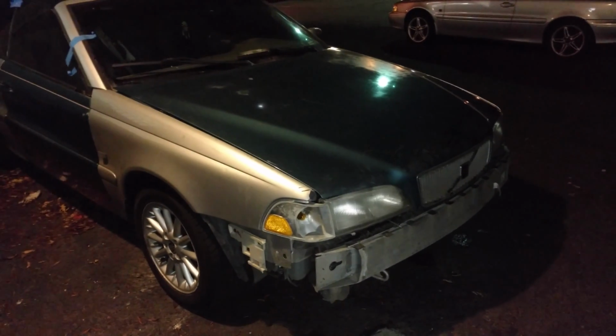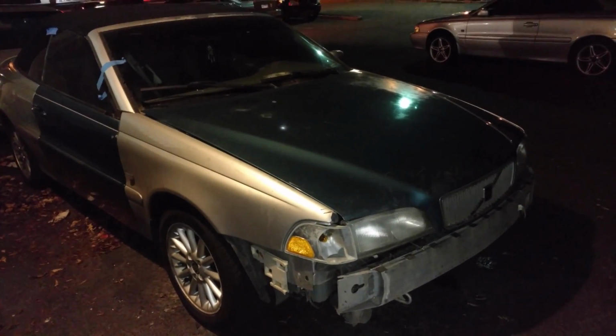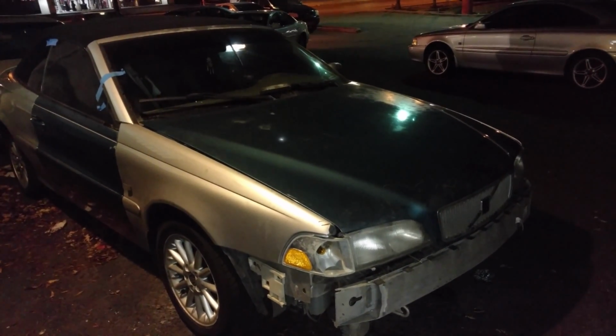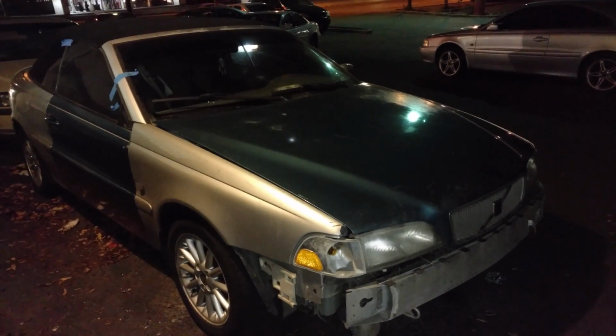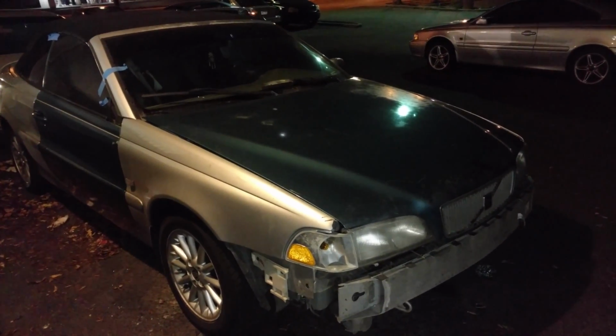We got this car started. It actually had a blown fuse. I was intimidated by all of those makeshift fuses in the fuse box that I didn't check all of them. But the security system alarm fuse was blown, and now it cranks and fires up just fine.